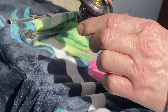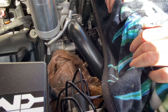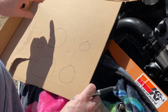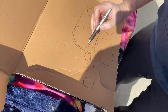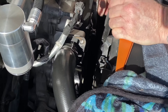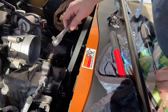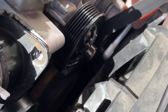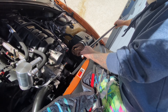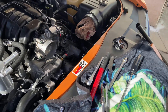It's a brand new 180. What's gonna be real hard is getting that bottom hose off — I've watched videos on YouTube and everybody struggles with that. I'm drawing a picture of the pulleys and how the belt goes so I know how to put it back on after I take out this old one. This is exactly how it goes. You need a 16mm to take off the tension of the belt. There's a hole — this fits in. When you use the plate, just pull it that way and the belt will come right off. I got a new belt I'm gonna put on after — this one's in good shape but I got a new one just in case.